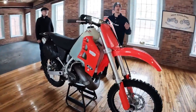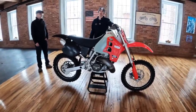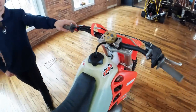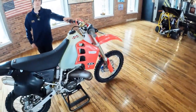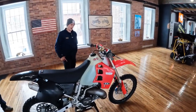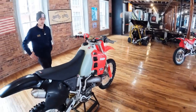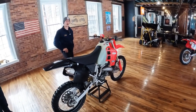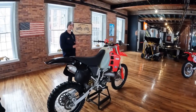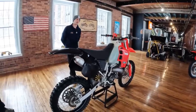To get it to be 100 percent is the tough part. What are we going to do vibration-wise? Pastrana was talking about filling the bars with silicone on the RMZilla. But my biggest takeaway from reading about the Team Green bikes — they raced KX500s until 2005 — is they would weight the cranks a bit differently. It's almost like adding a flywheel weight, but a bit different. It doesn't change the power curve as much, but when you add a bit more weight it reduces the vibration and settles the bike down at speed.